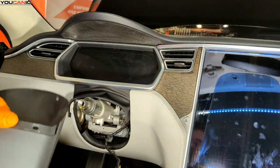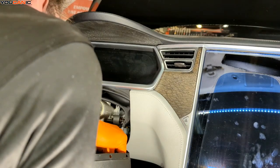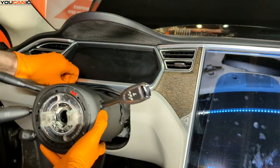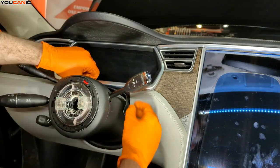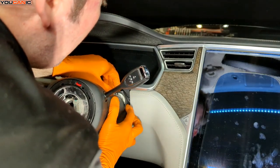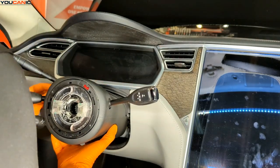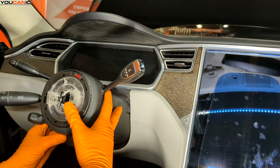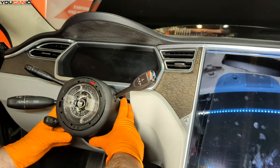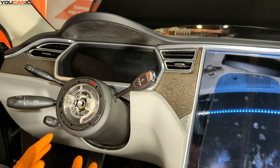So we are ready to install it. We have our electrical connection that we need to get back on there. We've got our safety lock already remounted in there so that we can just reach in here. Making sure that our safety lock is in there, going over the steering shaft so it will come out. We get this on enough where we can now install the clips on the back for our little skirt. Tuck it in there so it all continues to look nice, and now just push this back in — keep everything centered at the top and press it back. That's it — it's held on there and we are now ready to put our steering wheel back on.